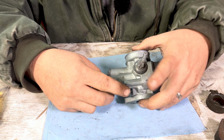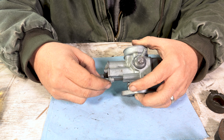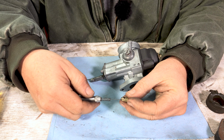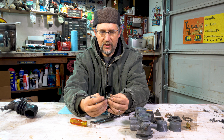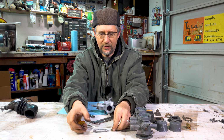It popped up because it has a spring in there. So when you pull all this out, what you have is the plunger, a spring, like that. And a good tech tip is just wrap tape around all that so you don't lose any of it. The plunger, the cable, and the spring, and just leave this all attached to the car like that. So you can tape it all up so you don't lose any of those parts.